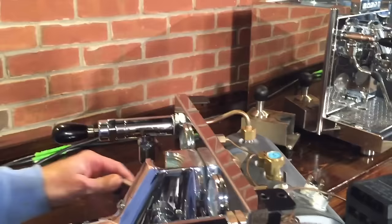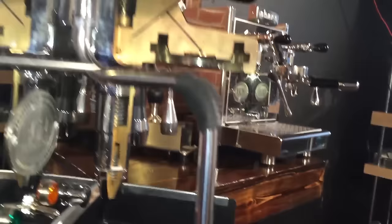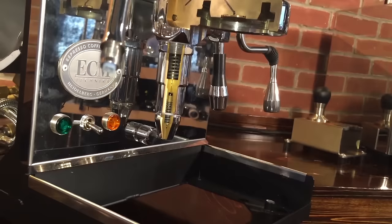We can take a look at this little cutaway of the wand on the steaming side so you can see how the anti-burn system works in a lot of these machines. There's a tube inside the tube — a Teflon tube inside of here that goes all the way down. They do get warm because the Teflon tube comes in contact with the steam wand, but they don't get dangerously hot. On this particular machine there's an O-ring there, and when you have the steam tip on, there's actually another O-ring that seals around the Teflon — so there are dual O-rings.